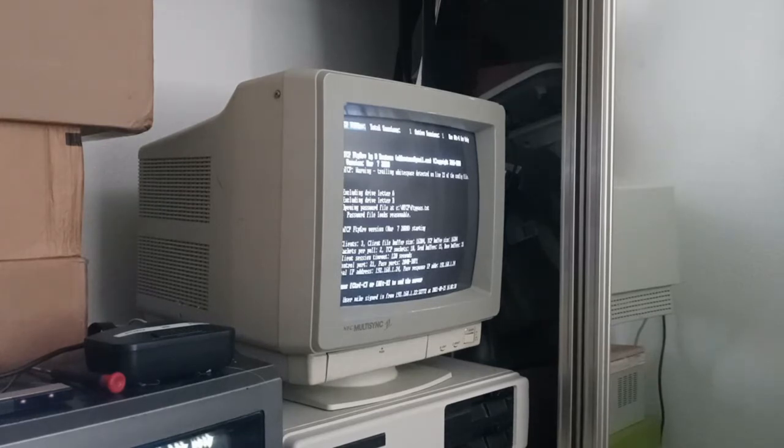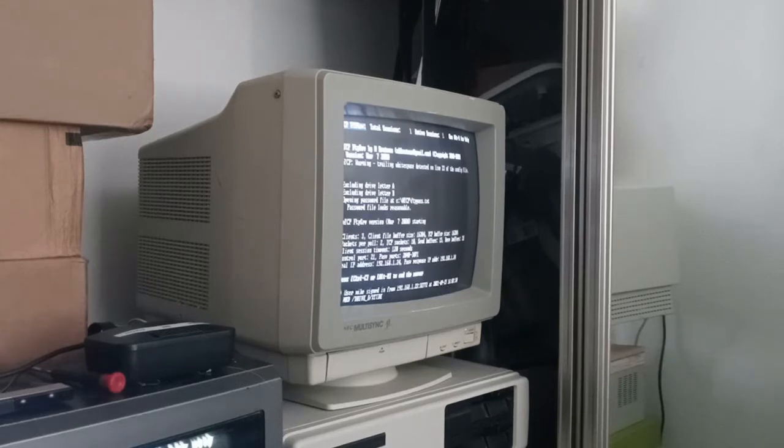Drive C and Drive D. I'm going to rename my file to the 8.3 file name convention, so it's going to be XT-IDE.zip. We're going to put it on my resource drive, Drive D. Create a new folder in there called XT-IDE. And then we're going to go into that folder, and then go to my downloads on my Linux box.